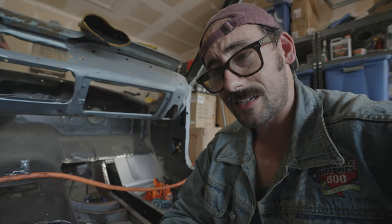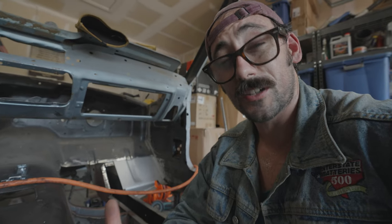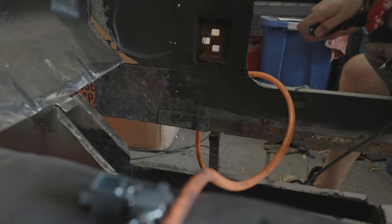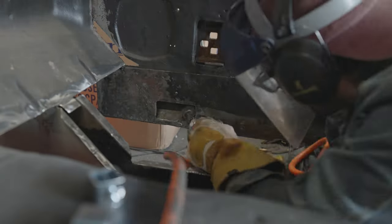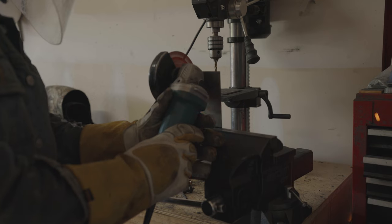I learned today that I'm probably going to have to do the upper portion of the torque box first on this side, then do the lower. But first I found some new rust to fix. Right there you can see some holes and a little bit of pitting. I'm going to cut a small extra square out and weld a new piece in — so long as it's not too bad on the inside. Mock up a little piece for the rust cutout, cut out the old stuff, weld in some new stuff. The rust actually went a little deeper than I thought, so I cut a slightly bigger square, cleaned it all out with a wire brush, and sprayed it down with some Steel-It.